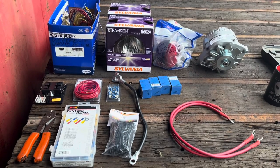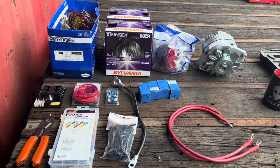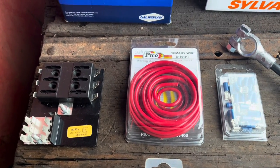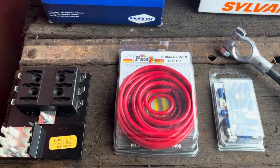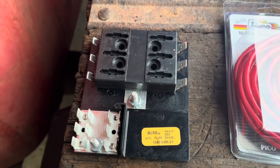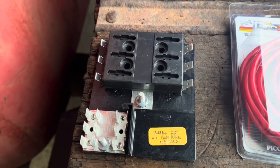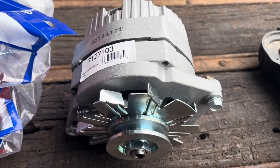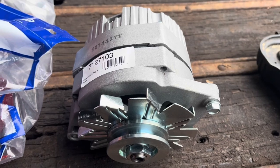The process is going to be the same or similar for just about any vehicle of this type — anything that was originally 6-volt, or really anything at all that has no electrical system to speak of. The ingredients are pretty simple and can be scavenged at any auto parts store or off a specialty supply truck. You're going to need a fuse panel of some type. Usually I like to use two — one for battery power feeds and one for key feeds — but in this case I think I'm going to make do with just the battery panel. This is the most important piece of the puzzle: any old General Motors self-regulated alternator. I found this one at my local supply chain. It costs $26.